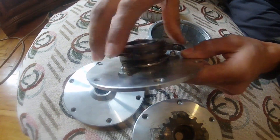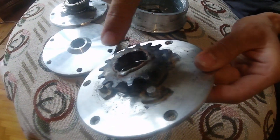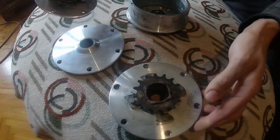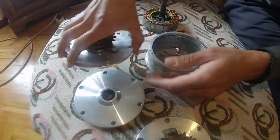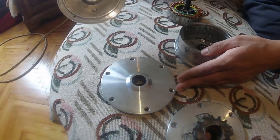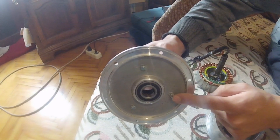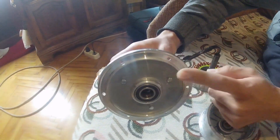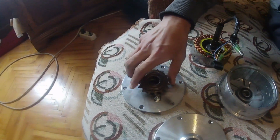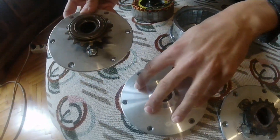You can use the part on the left-hand side that has no threads. Either you thread this free sprocket or attach by welding this fixed sprocket — this is 15 tooth and this is 16 tooth. You have to drill minimum three holes so it can hold the bolts; they have to be very thin so they don't hit the stator windings. These three or four holes can be anywhere in this spot.